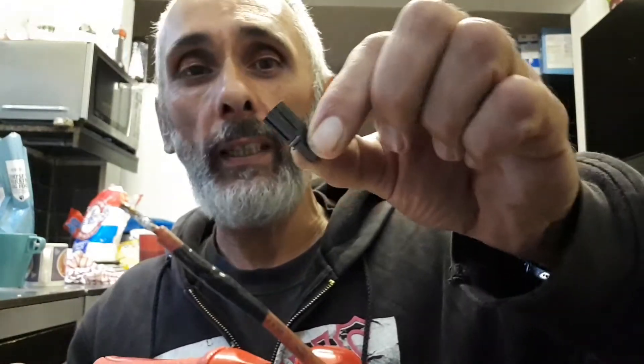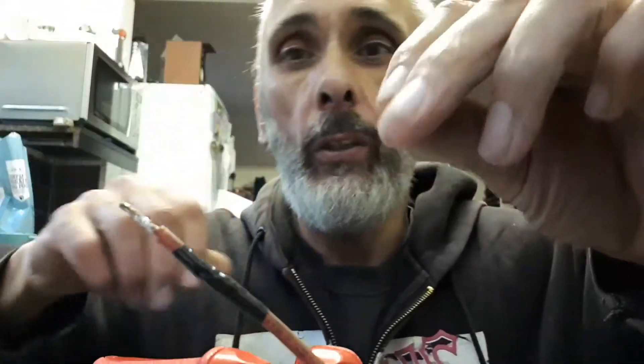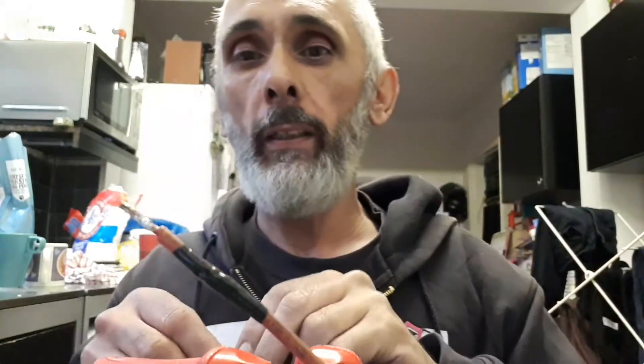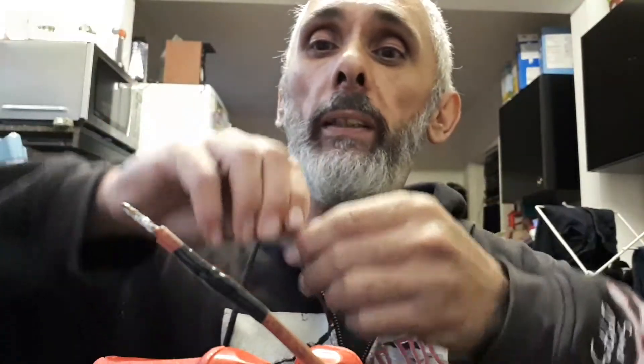This is the actual insulation clip which is a quick release to the PWR check device, and these are the small connectors which you could crimp on — like a little spade terminal with a slight bend on it. Nice aluminium, nice quality. I've decided to solder them on more permanently, so I've tinned the wire in advance.